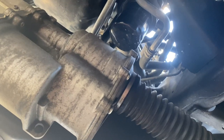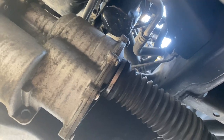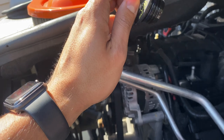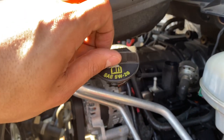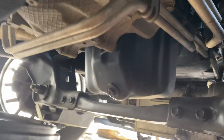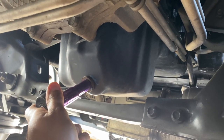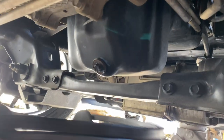Yeah, guys, it's really simple to change your oil. For those that go and pay to get their oil changed, it's a lot easier than you would think. I always take off the cap too — I feel like that helps relieve the pressure and really get it flowing once you take the drain plug out. Really easy to just break it loose, and now that it's loose you can just spin it with your fingers and let it drain out.